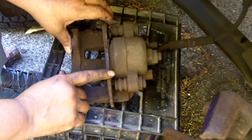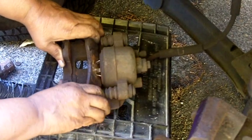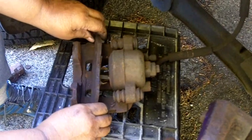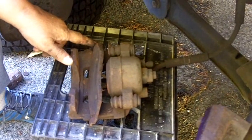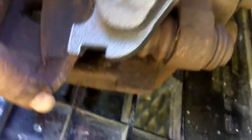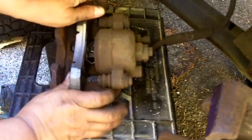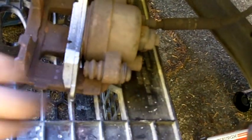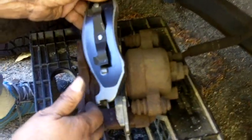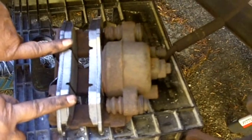Now I'm going to remove this brake pad from the piston — just pull out and it pops out just like that. When you put the new brake pad on, make certain you install the new brake shoes the same way. See where you've got the notch here — there's a notch there, and up at the top there's like a half notch. Take it, line it up. There's one. We're going to put the next piece on, and these little dots here — you want them to line up with the dots on the caliper. So our brake pads are on.